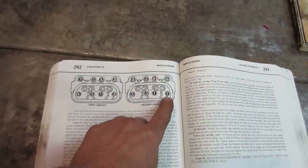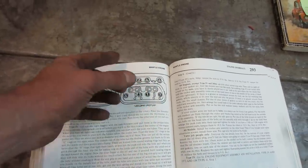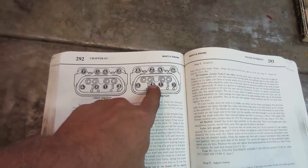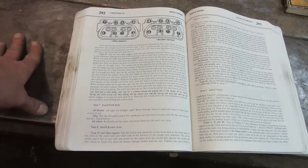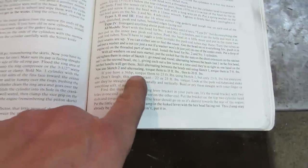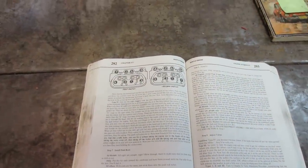So we're going to check that the head bolts aren't an issue. The tops of the head bolts are kind of hard to access — on a 36-horse motor you can actually see them, but on later motors they're hidden by engine tin. We can get to these though, so I'm just going to see if they take any torque. The 36-horse spec is 25 pounds and everybody else gets 22 or 23 pounds, so we'll set our torque wrench at 25 and see if any of them have loosened up.